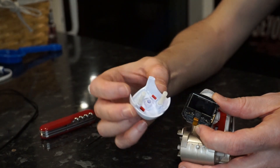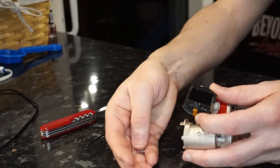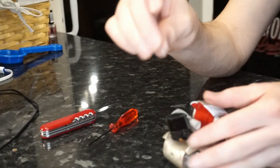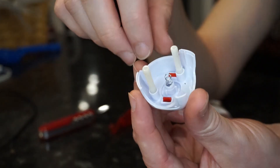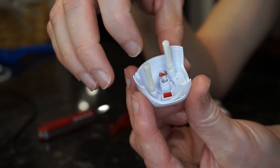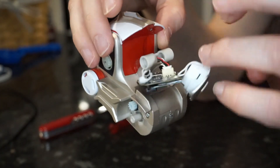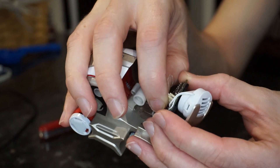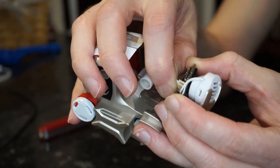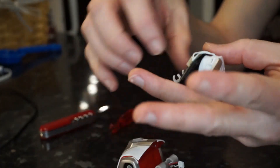The screen just rests inside the head on a post. Those two posts you see sticking up have actually got two screws in them, so if you leave them in it makes it a lot better to put it back together. A little spring just fell out there — for anyone doing this for the first time, that spring sits in the right-hand side of the head and holds the assembly together; when reassembling, make sure you've got that back in place. The Cosmo robot's face is just a little OLED panel connected by a three-pin lead that comes off easy enough.